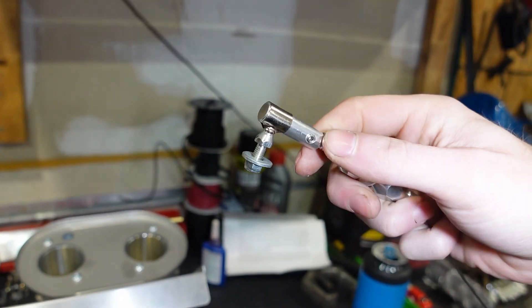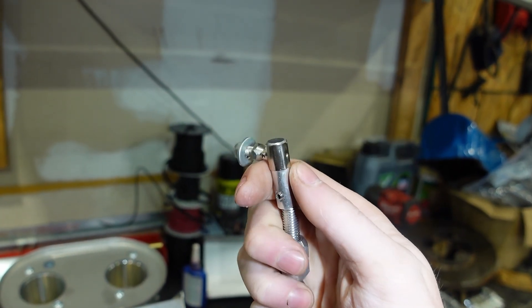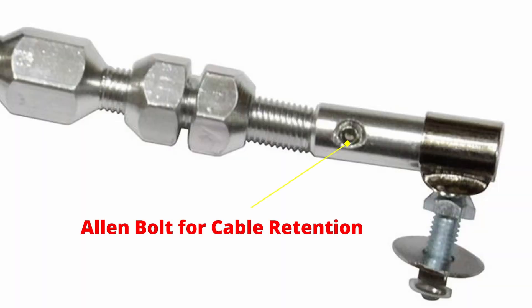Once you've completed this step, the gas pedal will have a hole that you can install the cable through bolt into. Install the through bolt but don't tighten it all the way down just yet. Reinstall the gas pedal, then fish the throttle cable through the firewall and feed it through the insert you just installed in the gas pedal. Pull all of the slack through and trim it down to where it will slip into the capture lug and tighten down with the allen key. Take care not to trim too much, as you'll have to order another cable if you trim it too short. Make sure you get it good and tight so the throttle cable doesn't slip and leave you stranded.